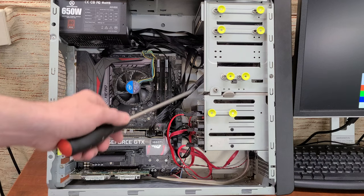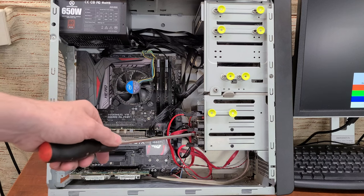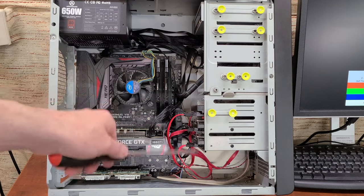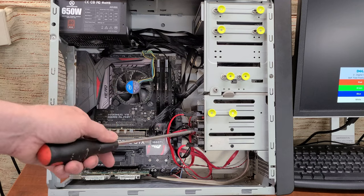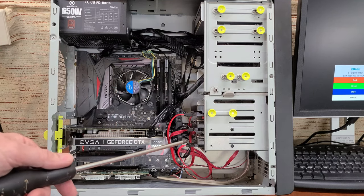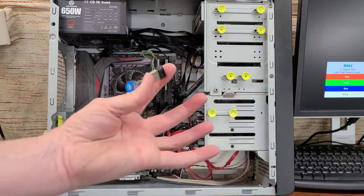We also have three 8TB hard drives — one will be a parity drive and the other two will be data drives. I do have more hard drives but it takes a long time to rebuild parity, so I'm starting small because you can always add drives later. Unraid only runs from USB, so that's all you need to add more drives down the line.